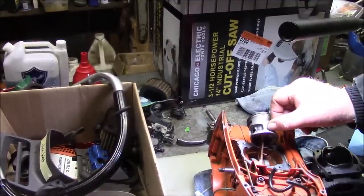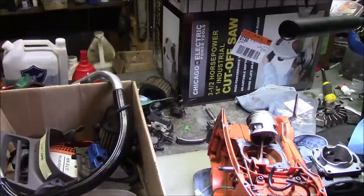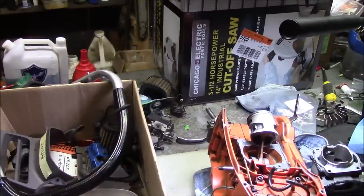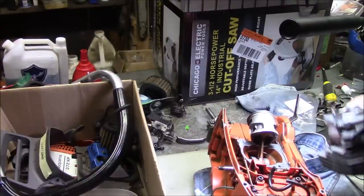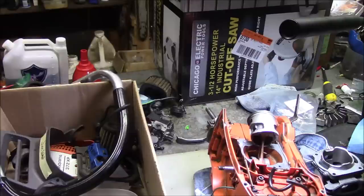But you pick up, I don't know, 20-30 thousandths, and it'll actually run a little bit better with a little more duration on these. I don't know why, but you can't go wider on that port, because next thing you know, you'll be right into those straddle ports. So just an anomaly, just one of those things.